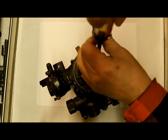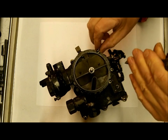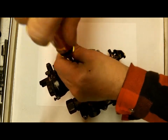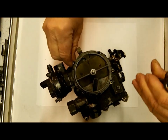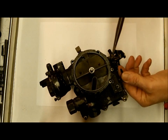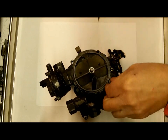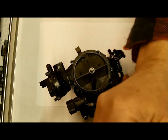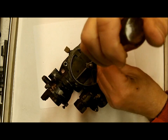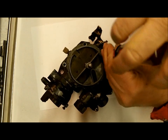I'm going to start out by just tearing it apart. Sometimes I don't do the teardown, but it's nice to see where the parts came from — it might help you remember where things went. This one is missing a linkage for operating the accelerator pump, so I'll have to find one. The purpose of this is to show you how to rebuild it. Fortunately these aren't too difficult to do — they're much simpler than the Rochester 2G, with fewer parts.